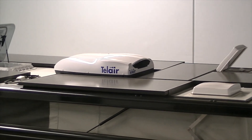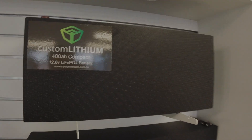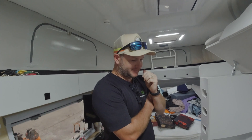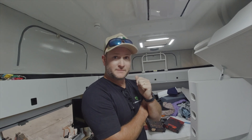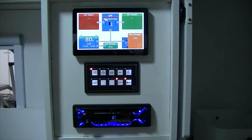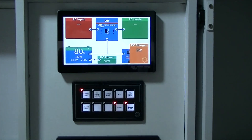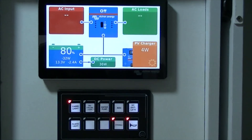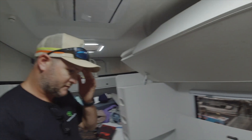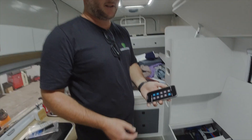So what's the capacity of the input of the MPPT? It'd be 150 volt slash 85 amp. What size battery have you got in there? That's a 400 amp hour — and it could have easily fit a 560 amp hour model. With 400 amp hours of lithium I imagine you can run your aircon? Yep, so we can flick the 240 volt on using the screen and that'll enable 240 across the van, so any of the original plugs will work, and we can also just use the remote to turn the air conditioner on. You said you've got Bluetooth control?